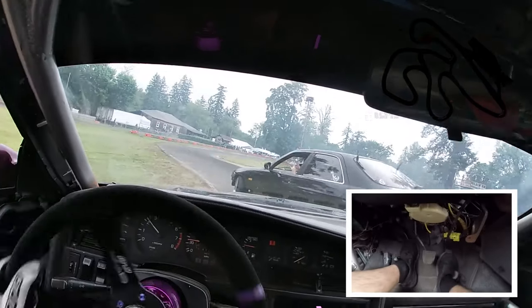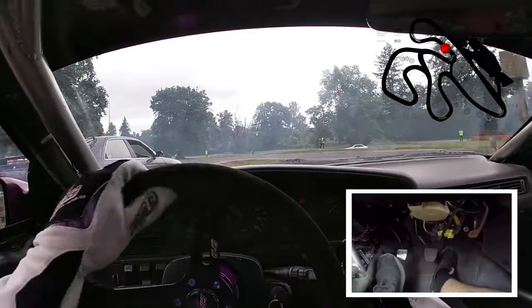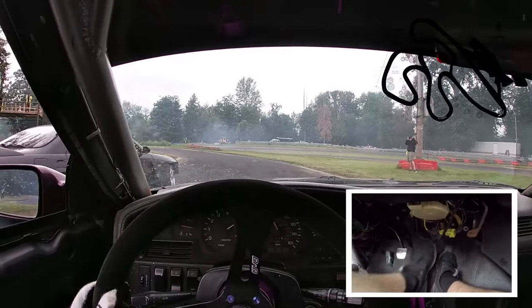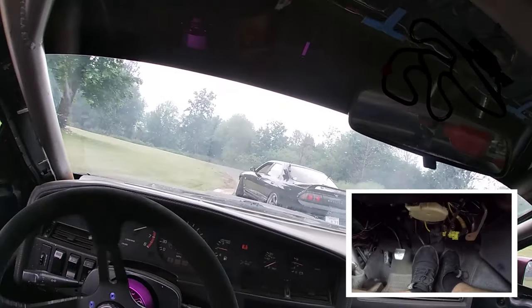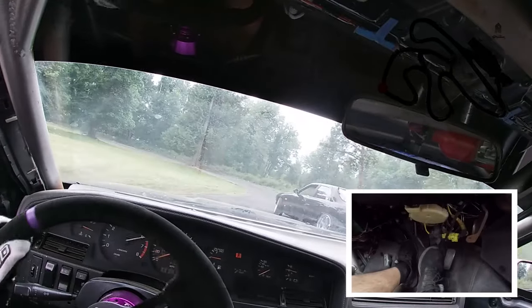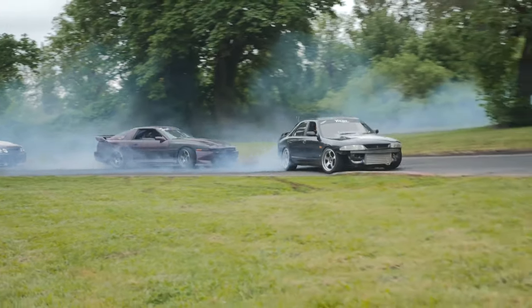So instead, I go left foot on the brake to slow the car down as it comes up into boost. The reason you wouldn't want to lift off the throttle is because with turbocharged cars, when you get back on the gas it's not instant — it takes a few milliseconds to come up to full boost. The bigger the turbo, the longer this takes. For my car, it's almost a quarter to half a second. You can lose two car lengths in that time, and we all know you need those door-to-doors for the Instagrams.